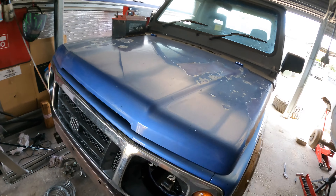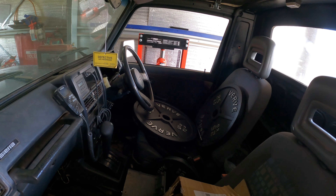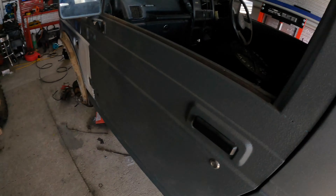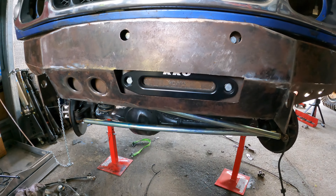I'm going to start on the panhard rods with the battery sitting there. I've got 100 kilos sitting on the driver's seat — I weigh about 95 but there's still a couple of other things to go in there — and then 60 on the back for a full fuel tank and full radiator. And the roll cage. I've just got a little come-along pulling on the chassis to keep it all centered to the diff.